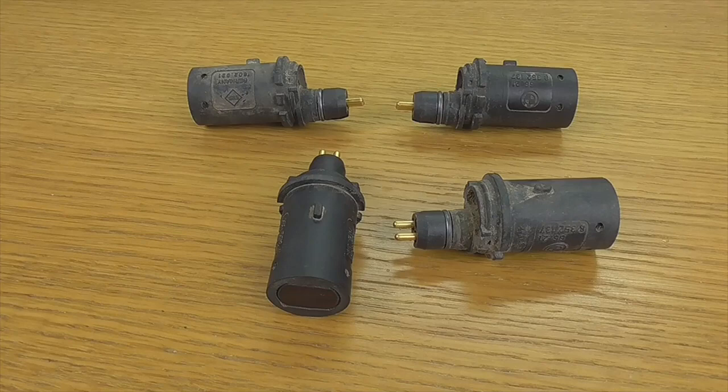When you find the faulty one, give it a few taps with your finger, because the connector may have moved — perhaps due to a small knock the bumper received — and sometimes it is even fixed that way. It is not the most usual, but that is the easiest test. The next step would be to disconnect and remove the bumper to access the bad connector. In some vehicles it is not necessary to remove the bumper, but in others, because all sensors are interconnected, if one fails then they all fail.